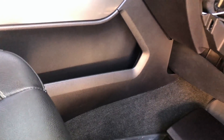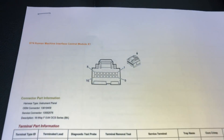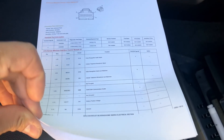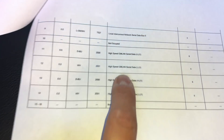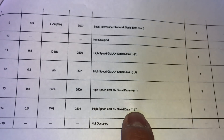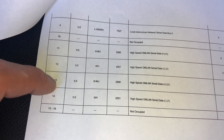So taking a look at the wiring diagram, what I've got here is the K74 HMI module X1 connector. And we're going to be looking at these four circuits. You've got GM LAN positive, negative, positive, negative. So essentially pin 11 and pin 13 need to be reconnected.